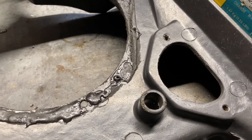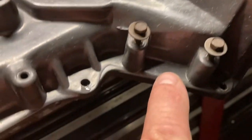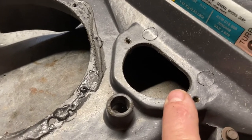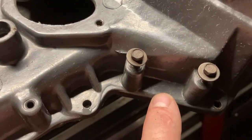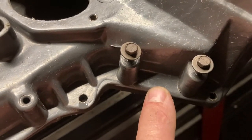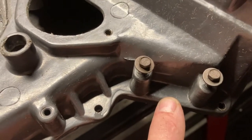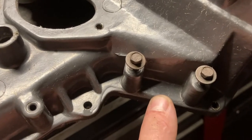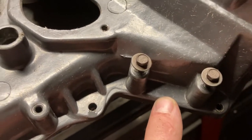And then all the way up full high is the energizing of the blower relay here. So the resistors are bypassed, and instead we have a one-to-one directly energizing the relay. And when that bridge, if you will, closes, that's a pretty big power draw there, maybe a 10 amp draw when that fan's on high, say in maximum cool or something. Anyway, it's as though you just ran it to battery.